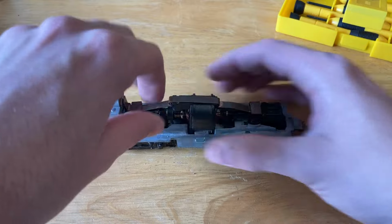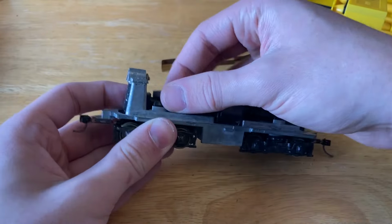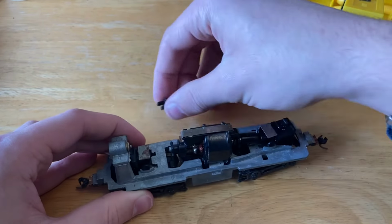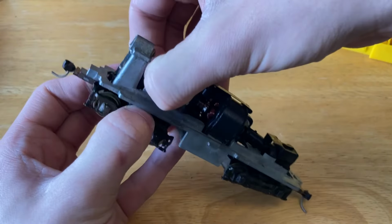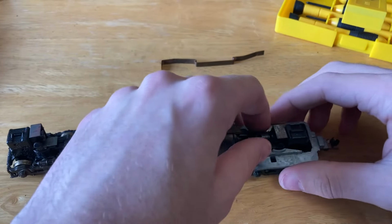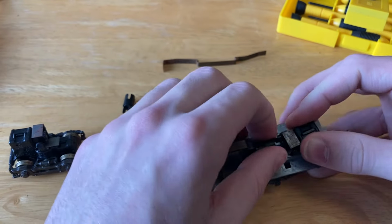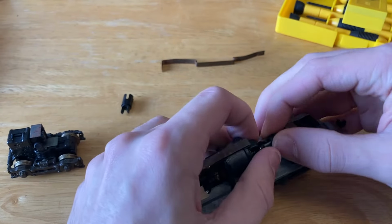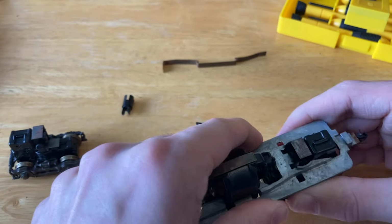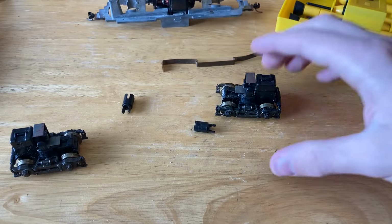And to do that, we're gonna take off this top wire. Then I'm going to remove this internal piece just by pulling it off. It snaps in place. Push in these two side pins. Should drop out. Yep. Go ahead and do that for the other side. There, they're both out. Just gonna set the motor off to the side.